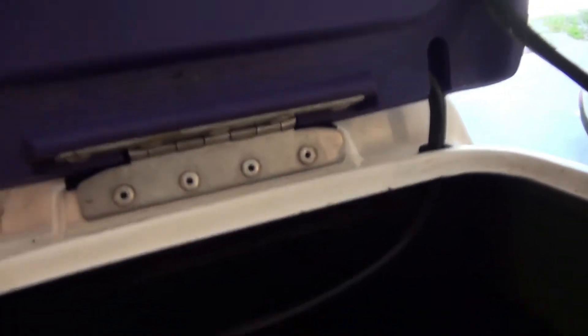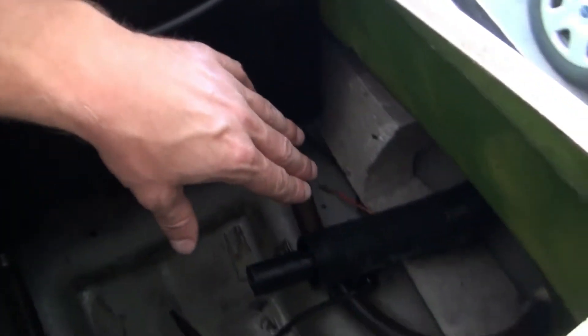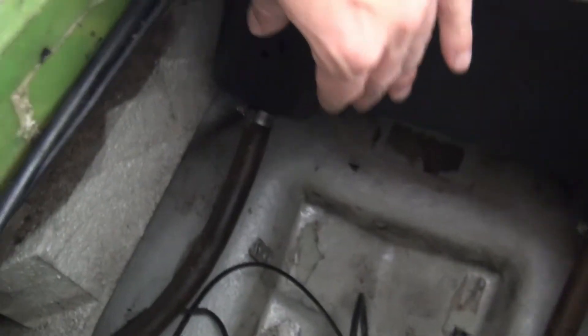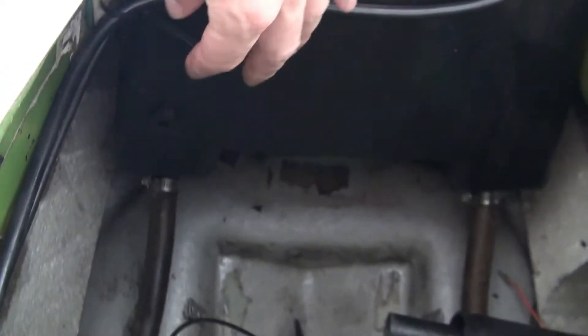So we've got this plastic piece here — it's a little dark and hard to see, but it's this whole plastic structure. We've got two tubes coming out of the bottom of it, and those two tubes run out to the side of the Sea-Doo. There's a little rubber grommet that is high up. So if and when water gets into this thing, by the forces of gravity it will drain out the side, and it allows the air to enter through the highest point underneath here. It directs the water through these tubes.